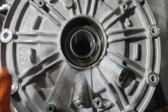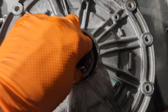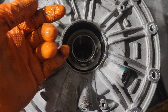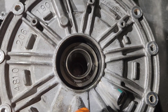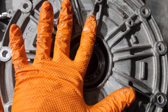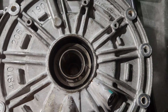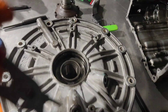There is a snap ring right there. When you remove it, tension is going to come off of this plate. To get it to go back in, you don't just press here — it will break this outer cover. You have to pull it from the bottom. We're going to use a puller with a threaded rod down through the bottom, put a nut on the bottom with a washer, and with the two arms at the top we crank it down — it compresses down while pulling up — and then we can sink the snap ring in from the side.